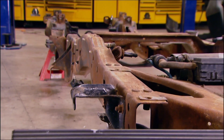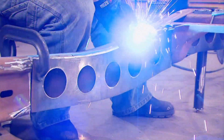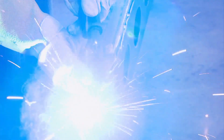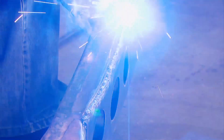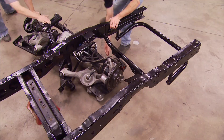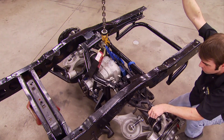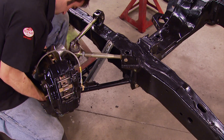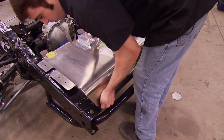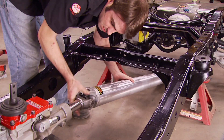A stock Mazda or Ranger frame isn't exactly the stiffest platform to build a track vehicle off of, so we added some boxing plates complete with speed holes, then welded those in along with all the cross-member junctions to make the chassis as stiff as possible. Then we dropped in our 4.6-liter engine and six-speed manual transmission, followed by the installation of an independent rear suspension out of an 03 Mustang Cobra. We also moved the front suspension forward five and a half inches for weight distribution, and put the fuel tank and battery towards the rear of the truck — better balance equals better handling.